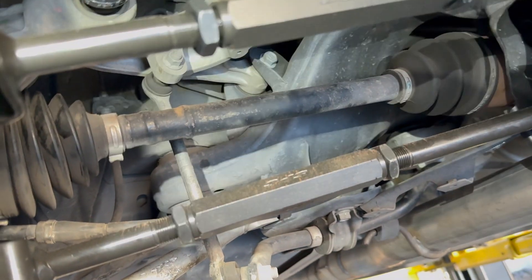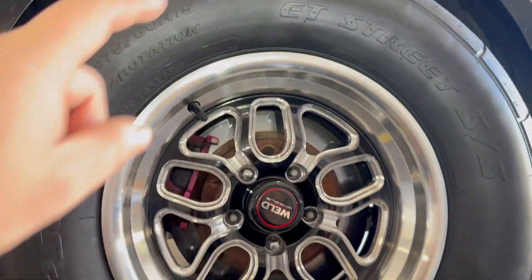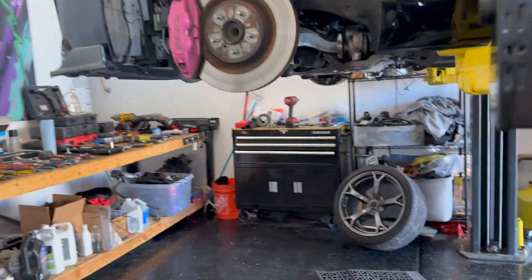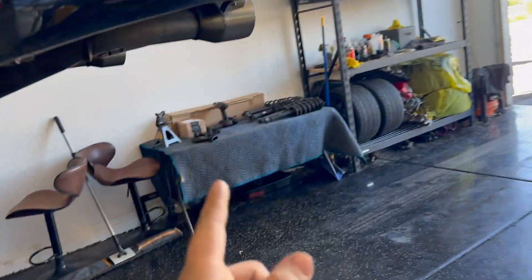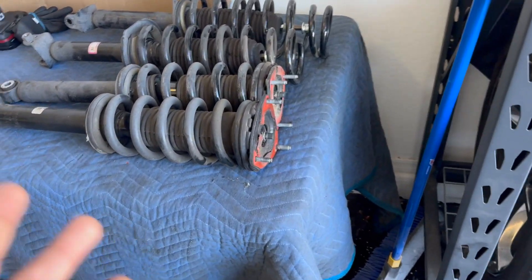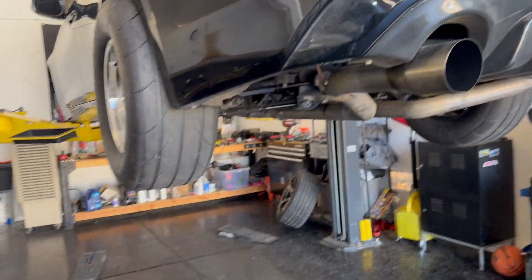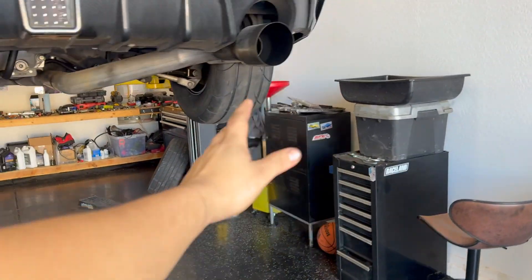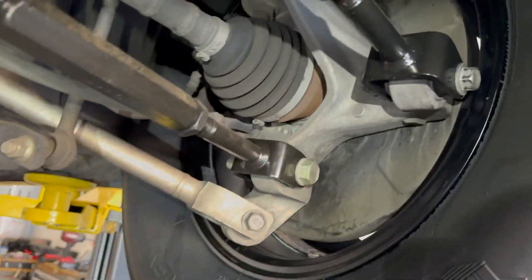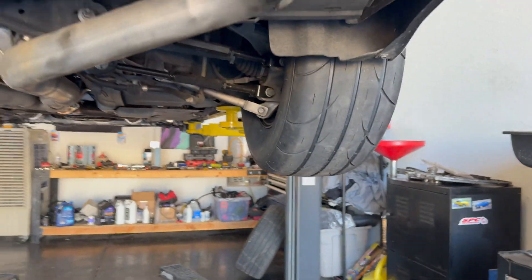Here she is — I already installed the rears. I got some SPC arms on as well. I test-fitted and the wheels look great now. It's not gonna rub because it would have rubbed on the other setup. I already got the front ones off. A lot of people asked me this when I was rocking the 305/45/17s on the RPF1s — I was on RSR downs, right here. These are great, the ride quality was just a little different than stock. I really recommend RSR downs if you're just looking to do springs, but I needed coilovers for the adjustability with these fat tires. I barely clear the control arms with this 15-inch setup — it's crazy.